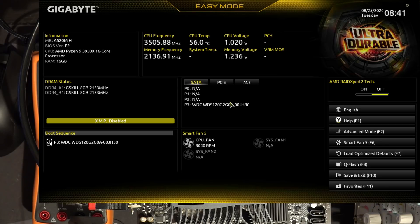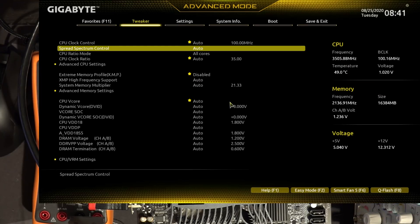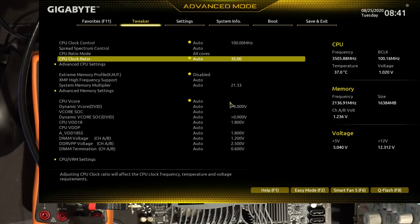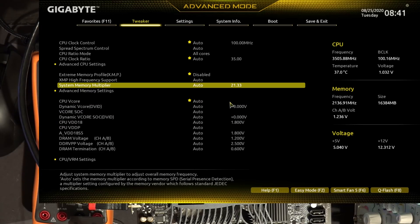So the actual temperature that the VRM gets up to - 100-ish degrees is not, like, for a VRM, that's fine. It's borderline, but it's still fine. There's a line, and a little over 100 degrees you haven't crossed that line yet. You really wouldn't want to cool it any other way. Also, if the room temperature was any higher - because the room is relatively cool right now, I'm gonna guess around 24 degrees - that would matter.